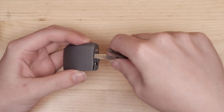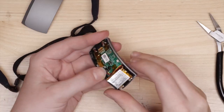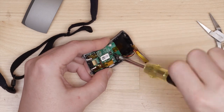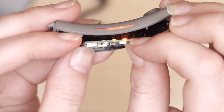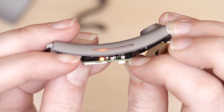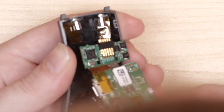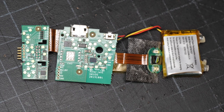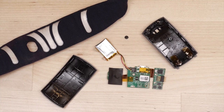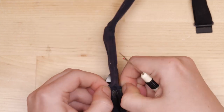This one is a treat, folks. The plastic enclosure popped right open without breaking, and the circuit is secured with just a few bits of tape and a single screw. We can see that the LED effect is achieved with some light pipes that sit up against a few side-emitting surface mount LEDs. I was able to remove the entire circuit assembly without breaking anything, and it's actually three separate circuit boards connected with flex PCB material. I used a seam ripper to remove stitches from one edge of the headband — there's a flex PCB sandwiched in between layers of foam padding.